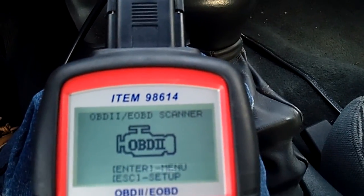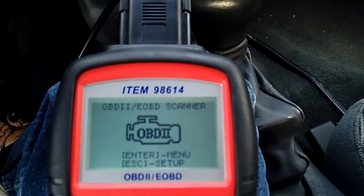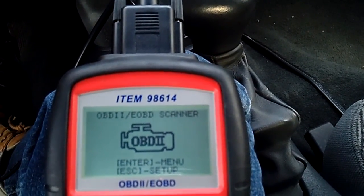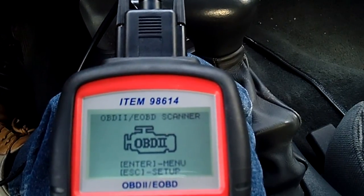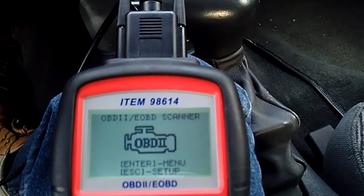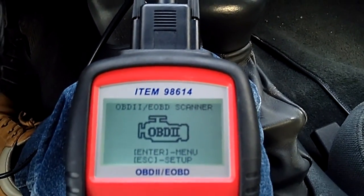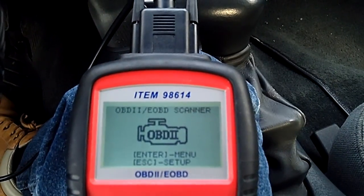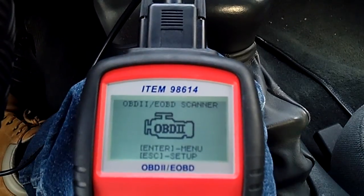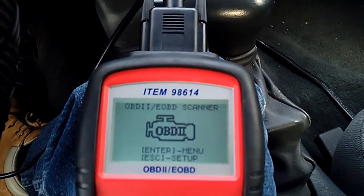So, as of right now, I do not have a check engine light. Basically, the post that I put up before was telling you about how I had a diagnostic code saying that there was a high voltage on the circuit for sensor 3 bank 1. There's 4 O2 sensors on this particular model of Blazer. The newer ones only have 3. When you look up the diagram online, it basically tells you it's the post cat, meaning the after-the-cat O2 sensor was giving me a high voltage.